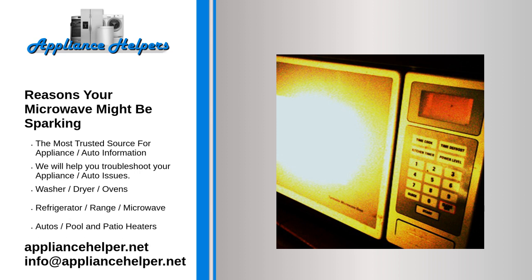Broken waveguide cover. This is a little more technical. When the unit makes the microwaves that cook your food, it projects them through a little panel known as a waveguide. When the waveguide cover is broken, your microwave is in trouble. The waveguide cover is in place to protect the electronics in the microwave oven. With a broken waveguide cover, steam and even food particles can build up in the electronics. If you notice sparking coming from a panel in your microwave, a broken waveguide cover is probably the cause.